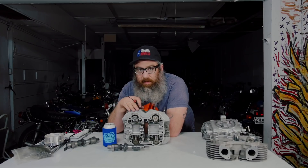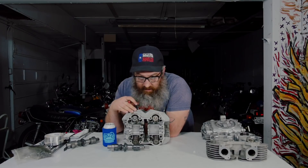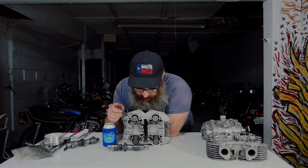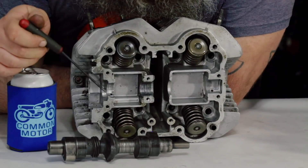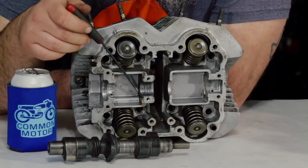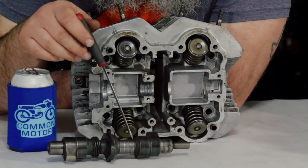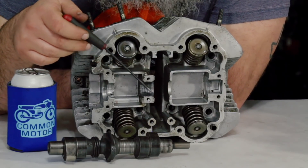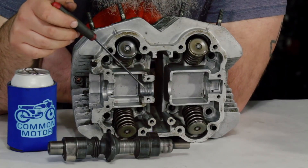What I have in front of me is a trashed CB360 cylinder head with a center cam journal that's pretty roached. This one actually happened to eat the center one and the outer one, but usually the center one is the victim of damage in these engines. Here's the cam that came out of the engine — the camshaft itself is also pretty roached. So this journal failure is pretty common on these engines.